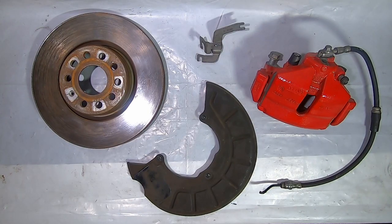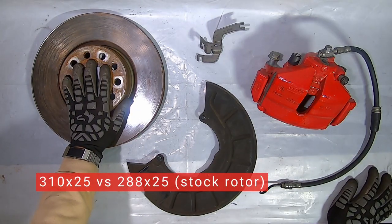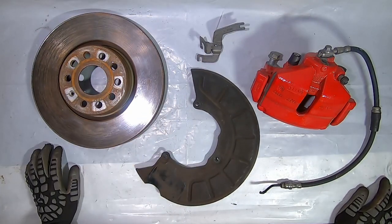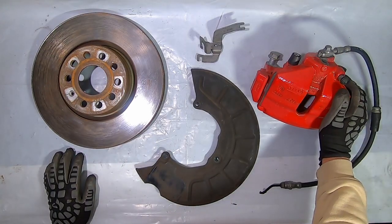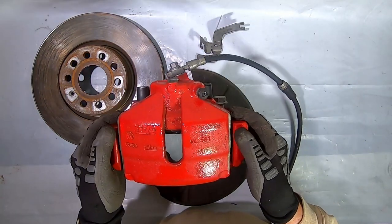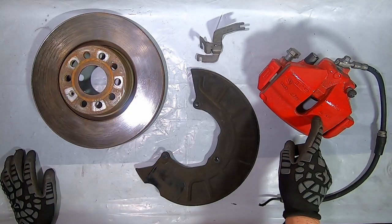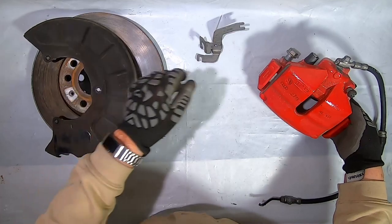This is the first upgrade we're going to put on the car today. This is off a GTI — either a Mark 6 or Mark 5. We have a rotor, this is a 310 by 25. The stock rotor was a 288 by 25. This caliper here — it's red — has a code on it, VL581. That caliper is the same one that's on my TDI. The only difference between this whole caliper and carrier versus what's on my car is the carrier itself.